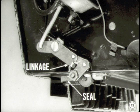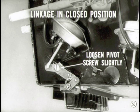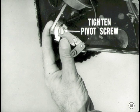Sometimes an air leak at the deflector occurs when the actuator linkage is out of adjustment so that it doesn't go over-center to apply enough tension to compress the deflector seal. To adjust the linkage, make sure the linkage is in the closed position by starting the engine and pushing the heat button. After stopping the engine, loosen the lever pivot screw slightly, just enough so that it can be moved sideways in the pivot bracket. Then, while pushing up on the deflector to ensure a good seal, twist the lever counterclockwise and toward the rear of the car. Hold the parts firmly in those positions and tighten the pivot screw.